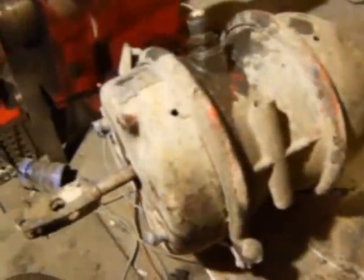This spring brake canister was so corroded — you can see it's basically peeling apart — that I had to torch it off. I don't recommend this unless you really know what you're doing with these spring brakes. They're very dangerous. You can see this one's caged. I caged it and then just torched the bolt. You certainly don't want to torch any other part of this mechanism.